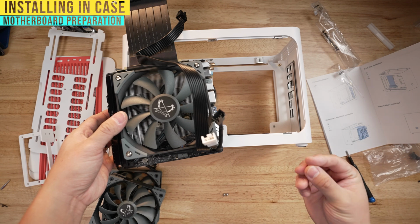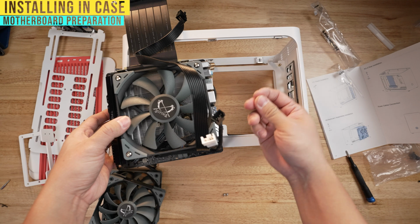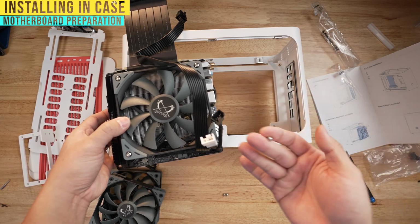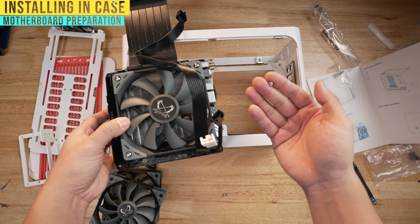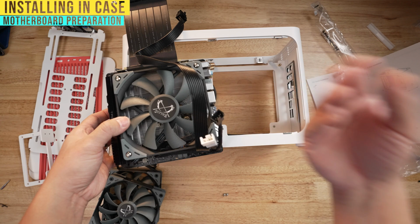And also, for the motherboard screws, they look like they've got little hoods on them. Be very, very slow and deliberate when you put these in, because if you drop one, it's going to get tucked under here and you're going to have to pull the whole thing out to put another one of these in. That's especially annoying when you've got 3 out of your 4 screws screwed in and then you lose one and you've got to rip the whole thing out.